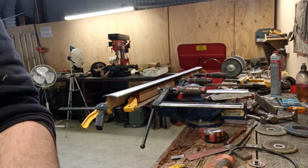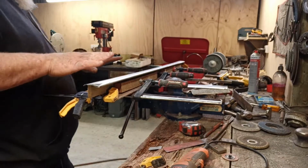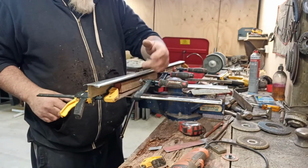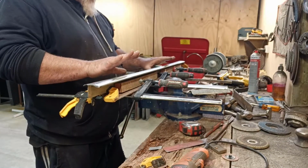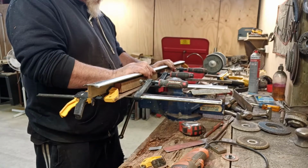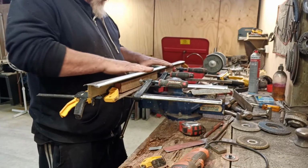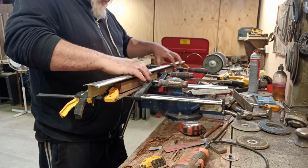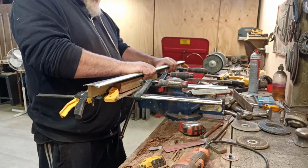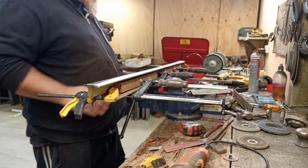Righty. So what we've got going on at the moment is the bend here, under here, wasn't very consistent. It was twisted. So what I'm trying to do is actually straighten it out and pull the center of this. I've done a little bit, but I've put some extra clamps in here with some bits of timber to help hold that in on that angle, so I can get this centerpiece to rock over a little bit better.